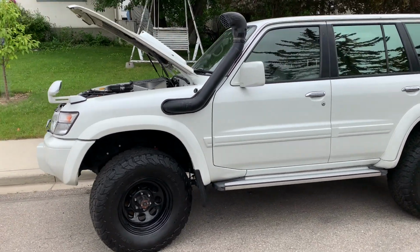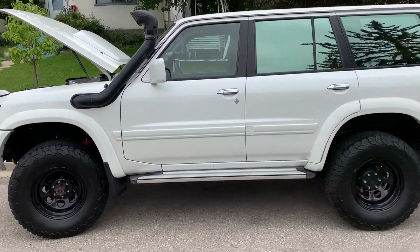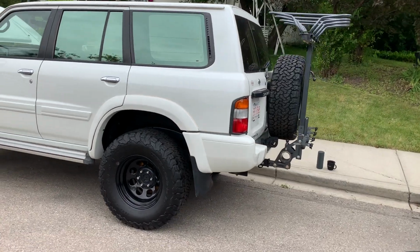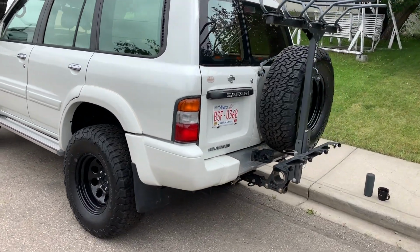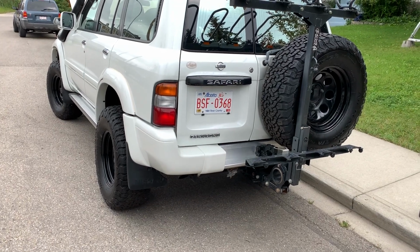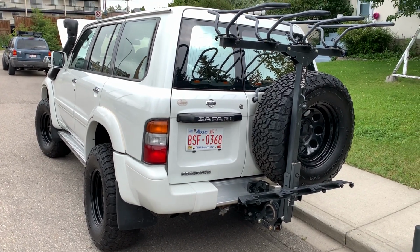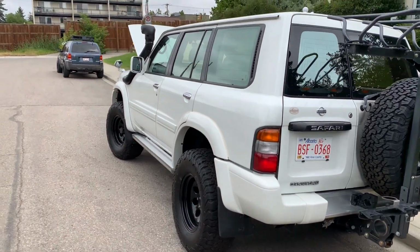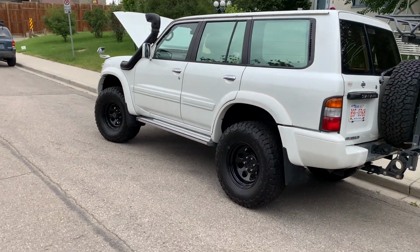That's why I switched out from my old forged aluminum Volk Racing wheels. They were just too narrow. These ones are heavier, but it transforms the truck. It drives like a sports car now, kind of, with the shocks and the heavy duty springs from Old Man Emu. Believe it or not, 3-inch on the front and only 2 in the back, and it's still back high.